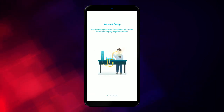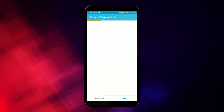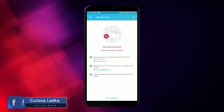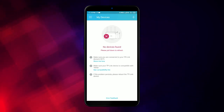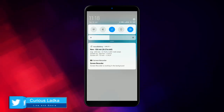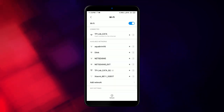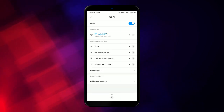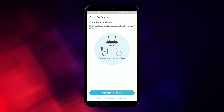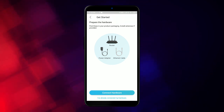You can see that I have already downloaded and opened the app. I'll agree to the privacy and terms of use, and I'll show you the full setup process. First make sure that you are connected to the Wi-Fi of the router you are trying to set up. I'll turn it on — this is the Archer C50, the E47A. The password is given on the back of the router itself. I'll tap that this is the wireless router. I have already connected the hardware — the ISP internet cable and the power adapter.